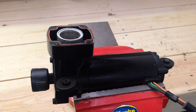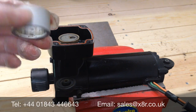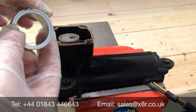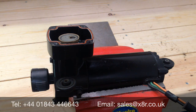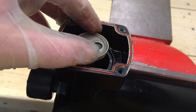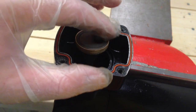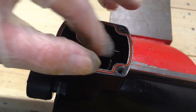The O-ring may be left on the piston liner — if it is, just take that out also. If you're going to reuse the piston liner, just clean that up. You can see quite a bit of remnant of the old seal in there, so give that a good clean-up. Do the same with the head — any residue of O-rings or piston seal, just clear that all up. You will then be able to see inside the piston seal, the part which causes the problems. This is one of our demo units, so it's actually got an aftermarket seal fitted, but this is the part that needs to change out.